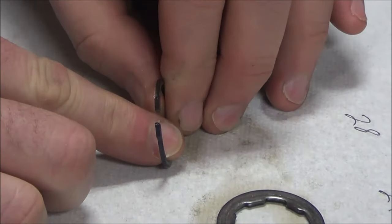On your lab sheet there's a part where I ask you to check the bearing, and I also ask: of the entire transmission, what is the most overlooked bearing inside a powersports transmission? This one right here — the shift drum bearing. You know why? They take it out, it's out of sight out of mind, and they don't mess with it anymore. This bearing does not get any RPM; all it ever gets is this back-and-forth motion. That's an important thing to think about.